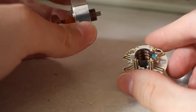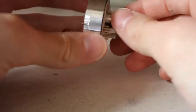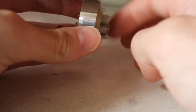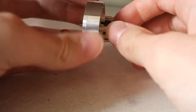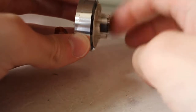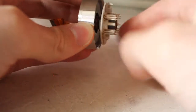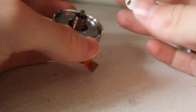I think the issue is with this transformer mechanism, because basically this has to sit on here and spin round with the heads. You can see that if we just spin that round freely, there's way too much friction. If I pull it out a bit it might spin better, but that basically just doesn't spin freely. And I think that's where the problem is. I really don't have a clue what we can do about it.